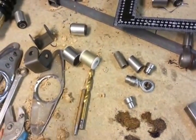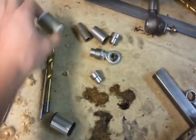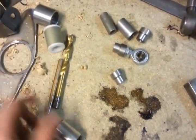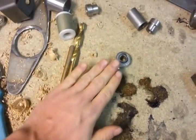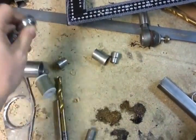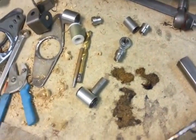I will show you what a K-link is later on. For the rear axle, I will probably use rubber bushings in the beginning — I will build for rubber bushings because they are a little bit wider, and then afterwards I can just change them if I want different ones. So in the end it will go like that, and then I have a pipe going from that end to the front. The front uses M12 — 12mm rod end balls. I will be welding those later on. The reason you want those in the front is because when you have suspension movement, this will move back and forth in 3D, so it's really good to have them. You can also use rubber bushings in both ends, but this is what I was recommended.